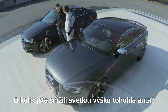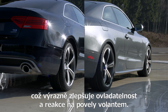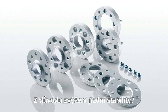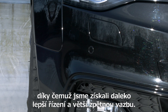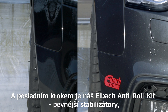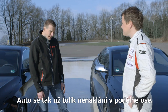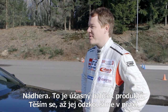How much did you lower the car? We lowered the car about an inch. That lowers the center of gravity, which improves the steering behavior. Next, we widen the stance with our Eibach Pro-Spacers — they're there to increase the driving stability. Exactly. It moves the wheel about half an inch further out and that gives us much better, more responsive steering behavior. And the final step was our Eibach anti-roll kit, consisting of reinforced sway bars that reduce the wheel load difference. The car doesn't roll as much on the longitudinal axis anymore. That's an excellent package and I'm looking forward to trying it out in practice.